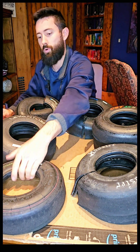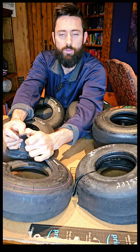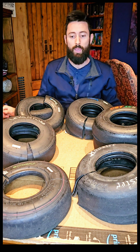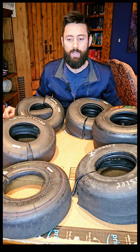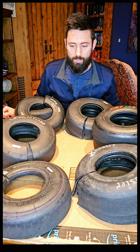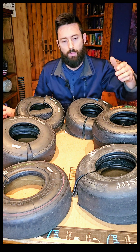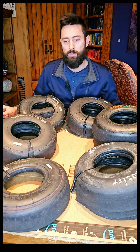Moving up in performance, we're going to the Mojos — the Mojo D2 and the Mojo D5. The D2 is very similar to the R70: it just doesn't have any sidewall. The D5 has the same problem. The Mojo tires used to have mega sidewall and were known for being extremely hard to mount. In the last homologation cycle they changed that — they took all the bead filler and apex out of there, so they're really easy to mount now. The Mojo also lays a lot of rubber. Mojo and Vega are the two tires that lay rubber out of this group, with Mojo laying a little more than Vega. But for shifter, both suffer from the sidewall issue — same thing as the Hoosier R70, although the Mojo was still able to keep within performance minimums to qualify.